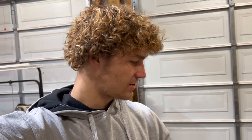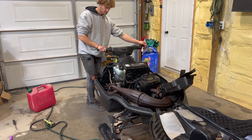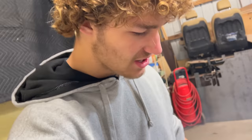All right, check this out. So I ended up just disconnecting the fuel line and reconnecting everything and kind of bleeding the system because I thought it had air in it or something. And watch this. A little bit of choke. Seems to run perfect. It's a little bit smoky, obviously. It hasn't ran in 7 years, I think they said.